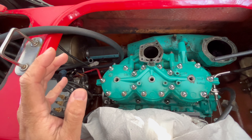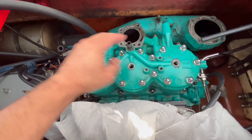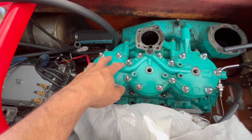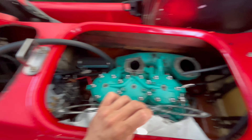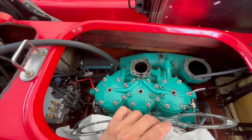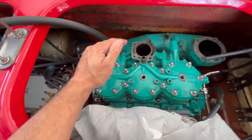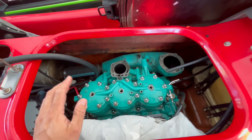Quick recap: I have checked the planing on this head and you don't want any warpage at all. If you have any warpage you need to replace the head — obviously that's easier said than done because this part is getting harder to find. Do not use a fiber gasket. The fiber gasket is a different thickness than the stock metal gasket, and using one that's a different thickness could change the compression ratio of this engine. Use a stock OEM gasket. If you're buying a set for $20, they're crap. This gasket is about $60. Get the right gaskets from Japan, or just don't bother doing it.